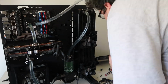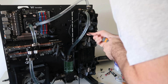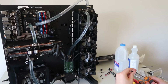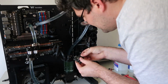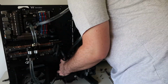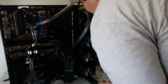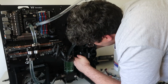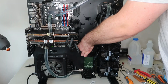Now I'm adding on 4 of these 120mm fans, which are the Cooler Master Jet Flow, so they actually have quite a bit of CFM compared to most other fans, and I'm connecting that up to a distribution board or a little switch that actually reduces the voltage on those fans, so I can switch between off, full speed at the 12 volts, and then a second speed which I believe is about 7 volts, which does make the fans a lot quieter and is what I use as the normal day-to-day usage, and that way I don't hear the computer screaming at me the entire time.